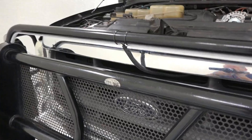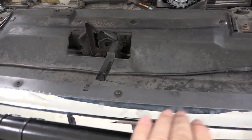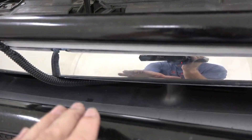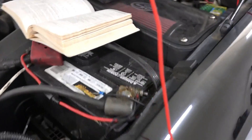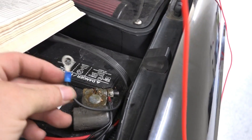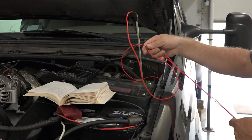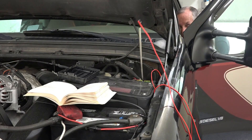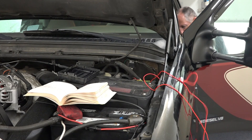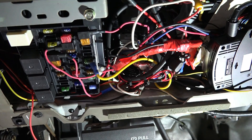Let me show you how I'm running the wires so far. It runs down — I didn't want to go over where the hood closes, or have anything on top where mechanics are working. So I went under the first vent for the radiator louvers, then came up inside around my battery. This black positive connection is going to go right here to the side of the battery. Now I need to pull this red wire through and make sure nothing's going to get tangled.